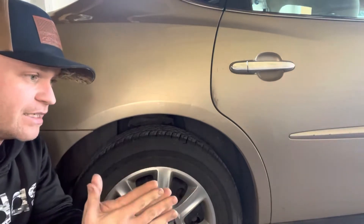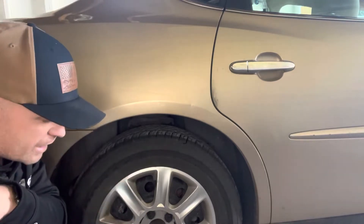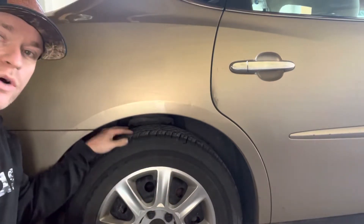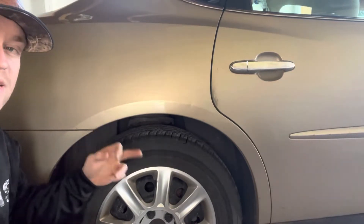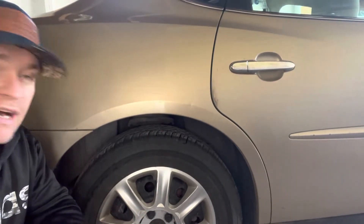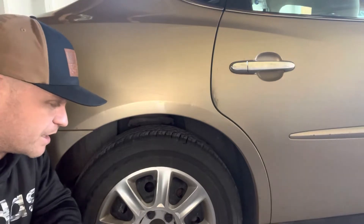First thing you need to do is assess what's wrong with the tire. If there's a hole in the sidewall, if the valve stem's leaking, or if there's a crack in the wheel from hitting a big bump, you're not going to be able to do this job. But if you just have a bolt somewhere in the middle and not too close to the sidewall on the outside or the inside, you'll be able to plug it. It's going to take me like $5 to fix it instead of getting something else, so let me get this up and get the wheel off.